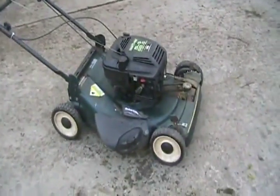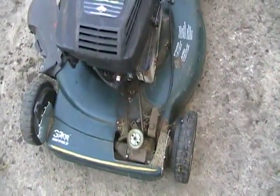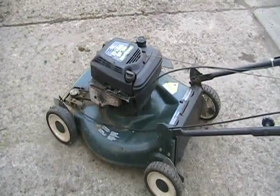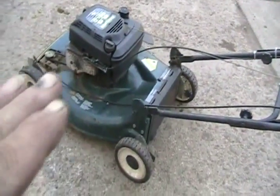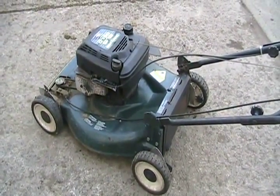Sweet — I can't believe it. Even the power drive works! I wonder why it was in the garbage with a sign that said free. I took the cover off to check the power drive mechanism before I started it and it appeared to function. If your mower starts and makes a whole lot of white smoke when it first starts, either someone tipped it and rotated the blade like I said, or it was stored on a heavily tipped angle — that causes oil to run past the rings and get in the combustion chamber. Always run it for five minutes before you decide whether it's a good or bad motor. Now just sharpen and pressure wash — we've got full detail for retail. Beer money. Sweet — this was less than a one-beer job.